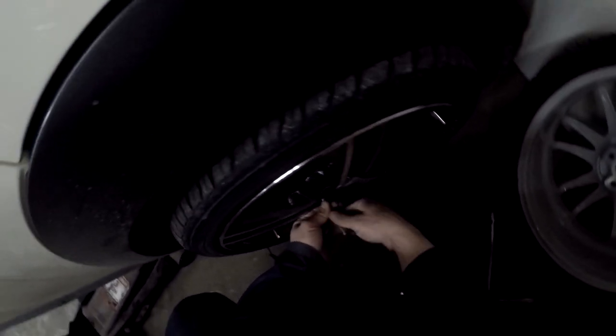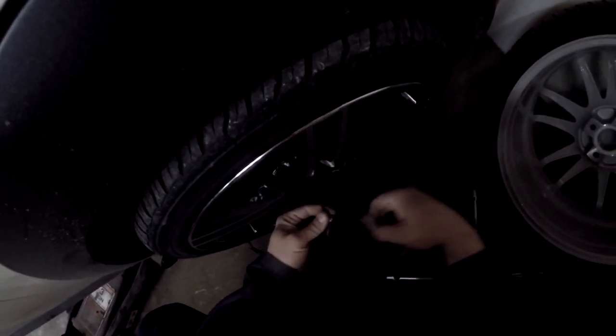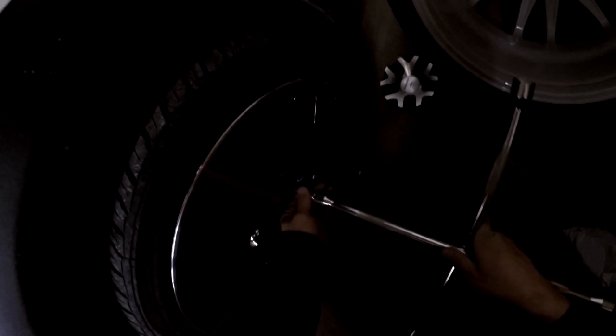When I go to store these, I put the center caps back on and keep the bolts with them. Center caps all fit a little differently — the screws are not all the same length and they fit a little different, so I want them to look right. I keep them together so I'm not constantly jockeying them back and forth trying to figure out which one goes where. Also, these are balanced — if they're not made the same, there might be a little weight difference that could throw your balance off. So once it's there, paired, and running smooth, I keep it that way.